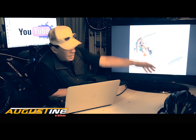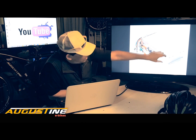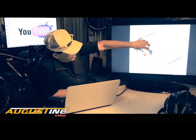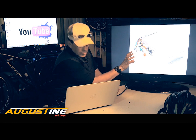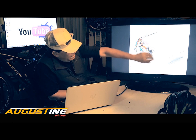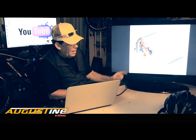The third piece, which is the brains of the operation, is your controller. This is about eight inches long by about three and a half inches wide and about an inch and a half deep — and this is pretty much plug and play. These pieces control everything from your pedal assist to your brakes to your motor and on and on. Very straightforward, very easy to connect. You can mount it under your down tube or behind your seat tube, depending on the space and configuration of your bike. So you need the controller, the battery, and the motor — and a bike. That's what you need.